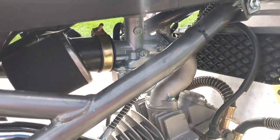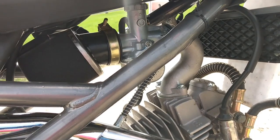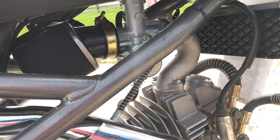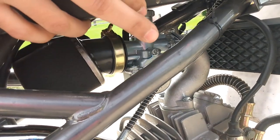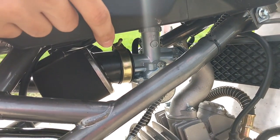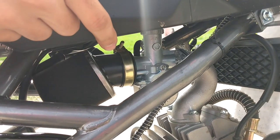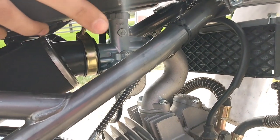First things first, it's those fake Mikunis — they basically look like Mikunis, it says Mikuni on it but it's not genuine. It's a VM22 26 millimeter. The only modification done within it is moving the needle clip to the top position, which lets the needle sit lower in the seat — that allows it to draw a little less fuel to lean it out a bit.